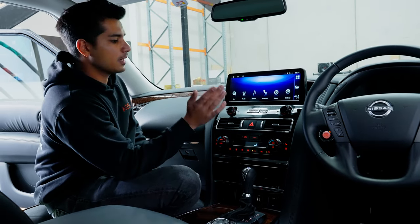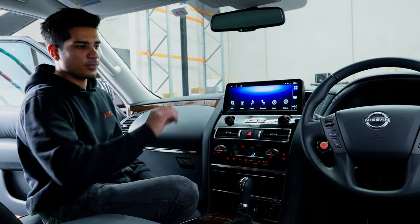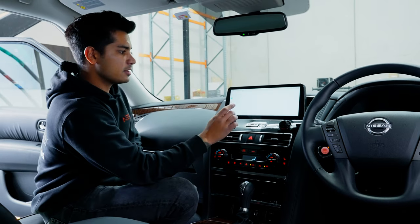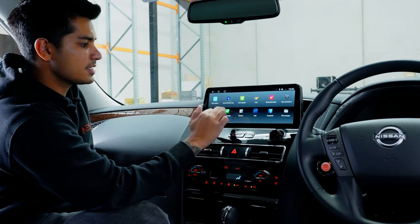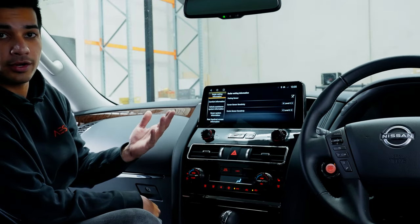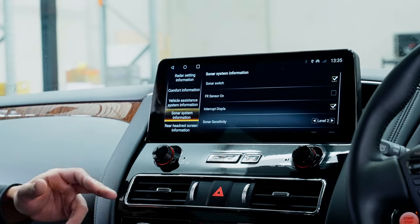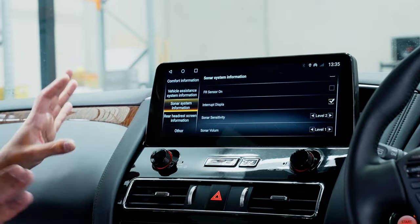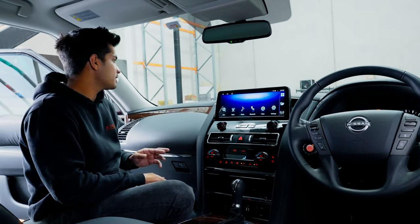The home button is at the top. The camera button brings up the cameras instantly, and they also activate automatically in reverse. It works with the factory rear screens. The hot and cold buttons for heated and cooling seats illuminate but don't function — you'll still need to use the physical dials for factory heated seats, or switches on the seats for aftermarket. Day and night brightness setting works with the key. Under car settings you can manage parking sensors — turn them on and off, adjust volume sensitivity, and control front sensor interruption.